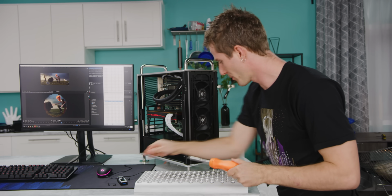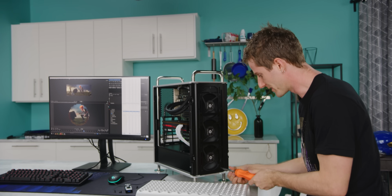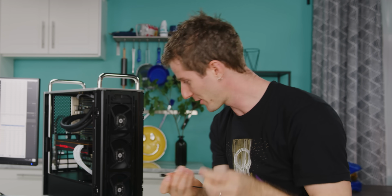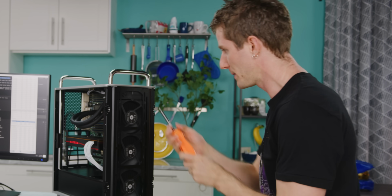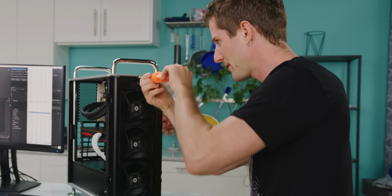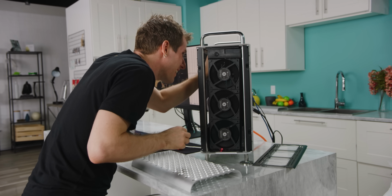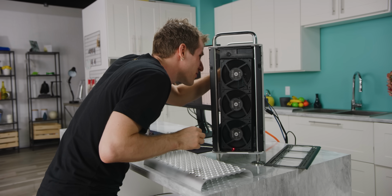When I stole the power connector for this thing, I missed one critical component. There's also an RPM sense wire that goes off your CPU fan header into the bottom of this that'll control probably not just your fan speed, but also your pump speed. So we're gonna go ahead and disconnect it, see if we can quiet this puppy down a little. And let's see what happens, ladies and gentlemen.